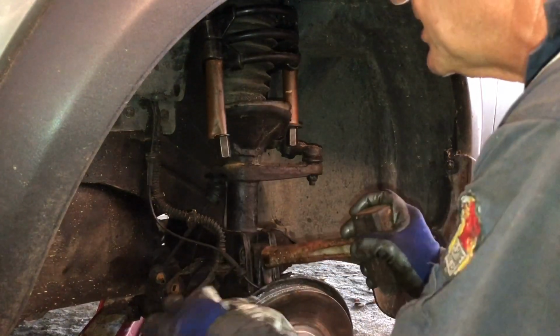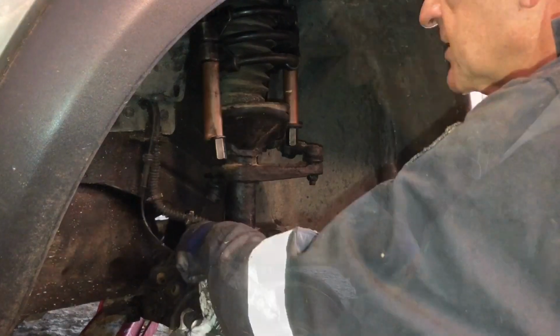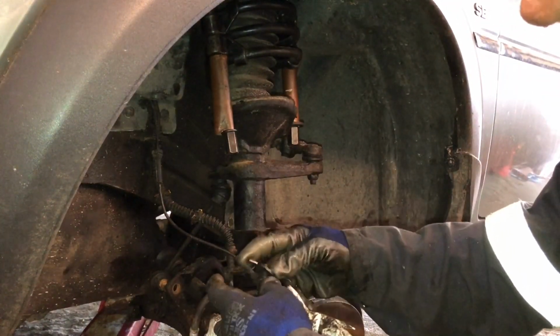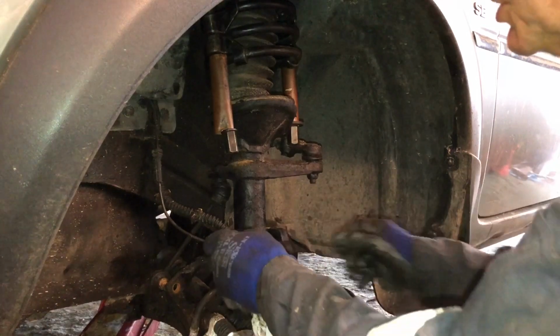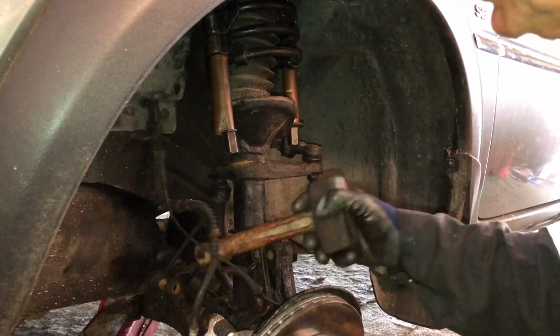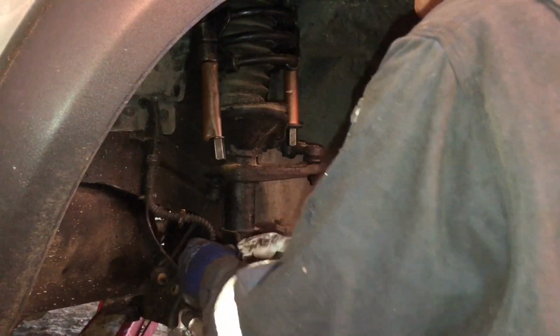Let's just push this in, these out of the way, and they suggest starting off with negative camber, which is this tab pointing to the inside of the car, and adjusting either the tab position or the lobe position, or both, adjusts the camber. You'll get the hang of it as you are basically looking at it as you rotate the bolt, and you need some method of measuring the camber, of course.